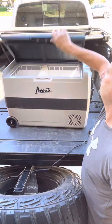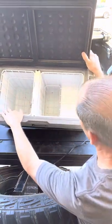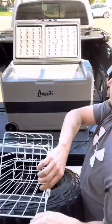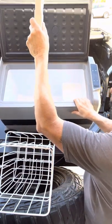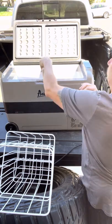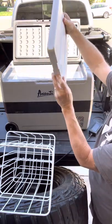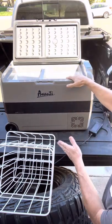It has two compartments — a freezer section and a refrigerator section. You can take out the middle divider and make the entire thing a refrigerator. What you cannot do is make the whole thing a freezer. If you move the divider left or right to make the refrigerator space bigger, it only makes the whole thing a fridge, because at the bottom there is a sensor that tells the computer to separate it into refrigerator and freezer.